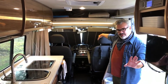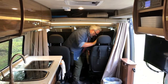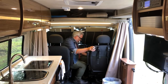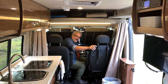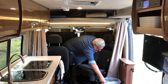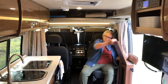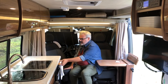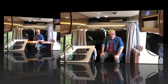The only real places to sit in the camper are these two captain's chairs — they're currently facing the wrong way, so let's turn them around. The chairs have a bar in front for forward and back movement, and two latches on either side of your knees. The latch on the inside left makes the seat spin — just pull up the latch and turn the chair around. Each chair also has a small fold-up table. The latch on the other side makes the backrest go forward and back.